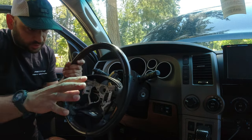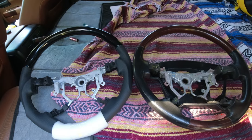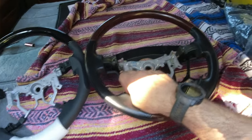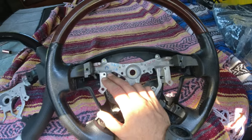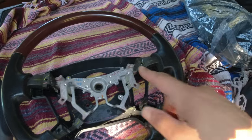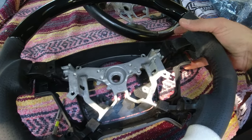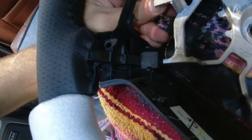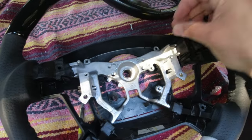It's not as simple as putting on the other steering wheel — all this plastic needs to transfer over. Let's move over to the workbench. Since we have our seats flat on the Sequoia, what better workbench than using the car itself. There are plastic bits here that need to get transferred over — really just these two things that hold the bolts, and then the back piece. There are two Phillips screws and that's it. That popped on really easily. There's a little bit of a bind on this T30, but got that in. Everything's snapped in, it's all flush. Throw in the two screws.